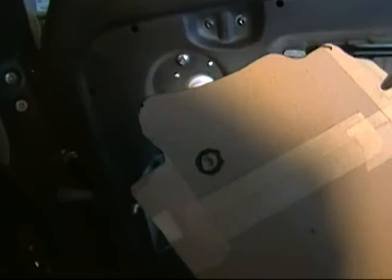Here's a cardboard template I made to fit up inside here. It's a pretty complex shape, but I need to mark all the areas where it'll go in as well as the bolt for the hood hinge. I've massaged this template to fit in there just perfectly, and I've created this one out of sheet metal.